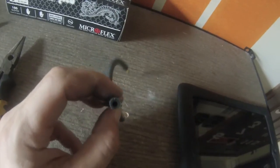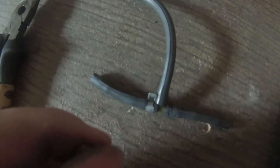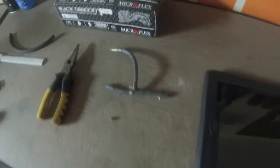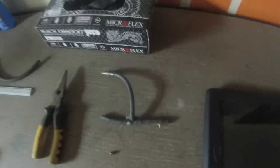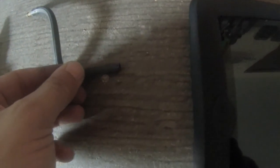Now you want to be really careful when you take it out not to damage this hose. This hose has a special lining inside for the oil. So you just want to make sure that's nice and clean. Clean inside the hose, clean this whole tee off. When you reinsert this, you want to be really careful that it doesn't get lodged sideways